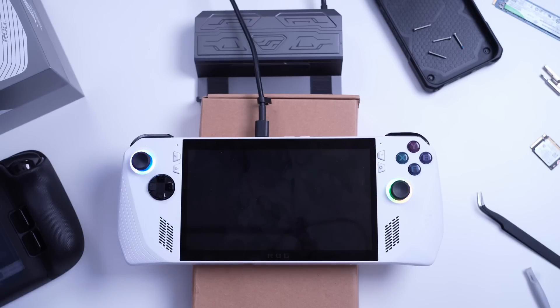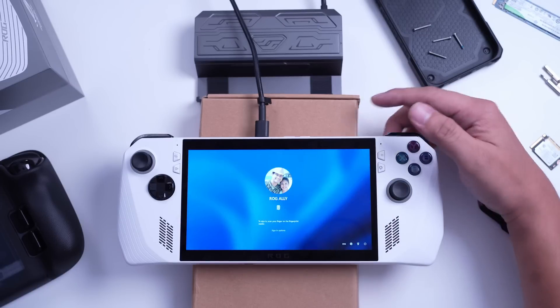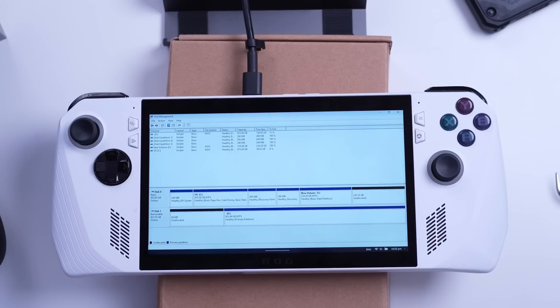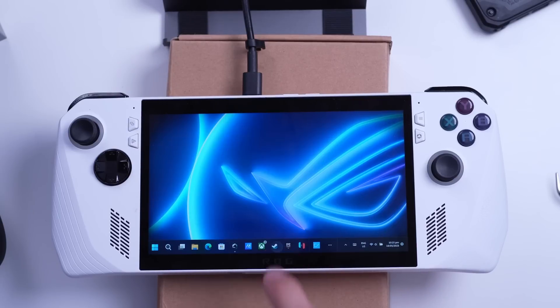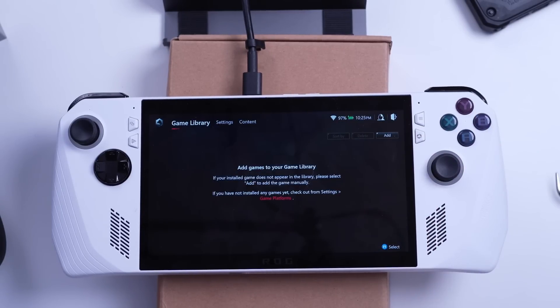This is only with the assumption that you have successfully cloned your original ROG Ally SSD so that the new one would automatically boot to Windows. As you can see, this ROG Ally is now at one terabyte as seen on Windows Disk Manager. I still have 250GB left, which I'm reserving for the future release of Chimera OS or Batocera. I also have the option to extend my current partitions to increase space or shrink them if I wish to have additional partitions.